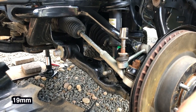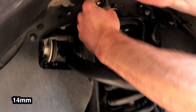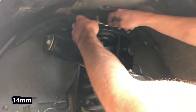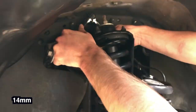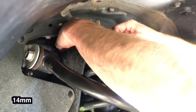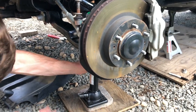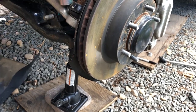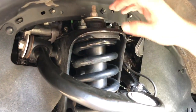Take the washer off and put that to the side. On top we've got a 14 millimeter socket — there are three bolts holding this thing down. Once you break them loose, they come loose by hand. To keep the pressure off those nuts up top, I'm going to give myself a little bit of pressure on the bottom here, just to take the whole load off. That way you can loosen them by hand instead of the whole shock slowly falling down.